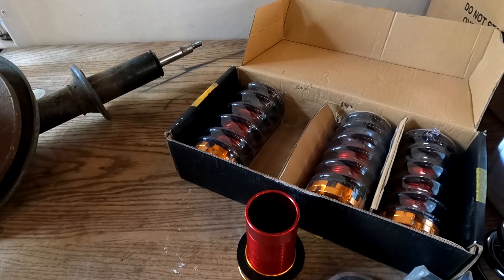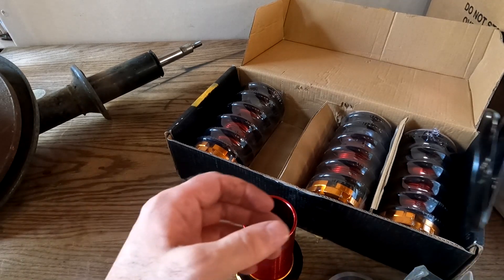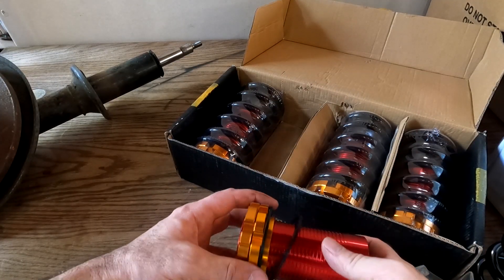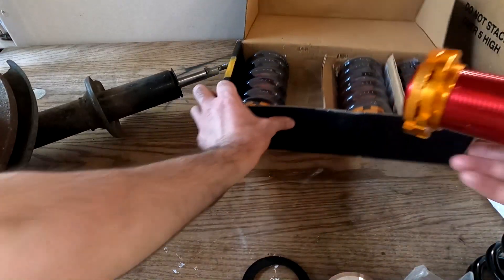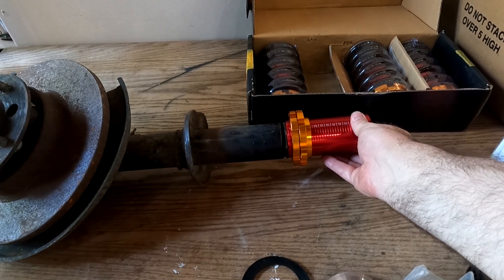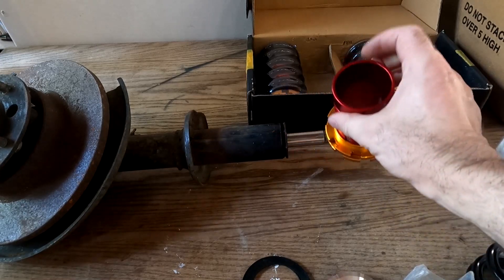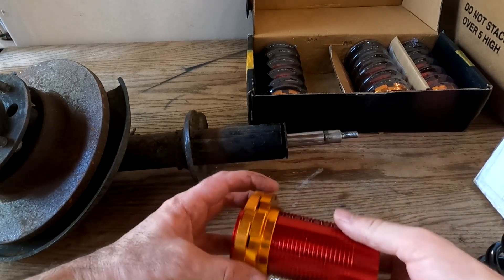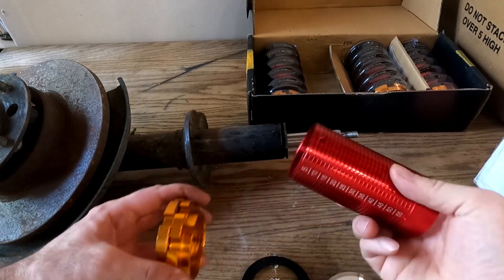From the start, I'm going to eliminate those, get rid of all the springs and buy some springs at the rate I want from Summit Racing. I don't even know what spring rate these are. The other problem is: here is a 280Z front strut. Even if you take out the strut insert, these don't slide over. These are perfect for a 240Z front strut, which is a slightly smaller diameter, but the threaded sleeve doesn't work on a 280Z.